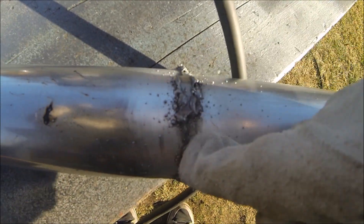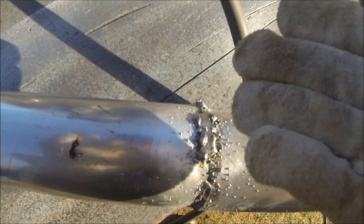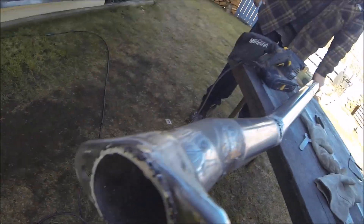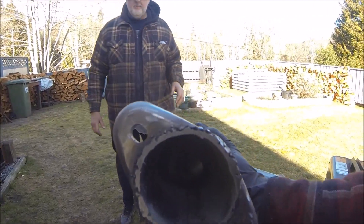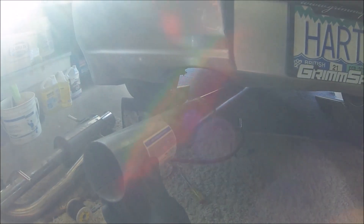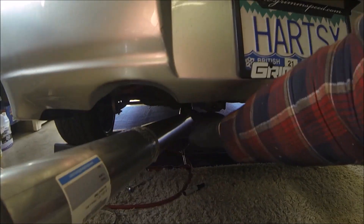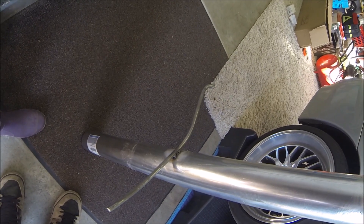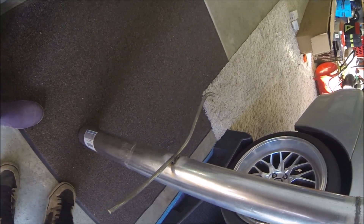I know it's horrible, but I had to get this extra piece of metal in there because it got a bit too hot and went through in a couple places, so I had to cover that up — but other than that it was fine. Just got this on and cleaned it up, so now time to test fit and then build the hanger. It hits on the frame so we need to make another cut a little bit farther down. That's three cuts in there now — we got a hanger on there, all that's left is cutting the end down and angle cutting it so it lines up and looks better.